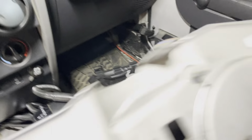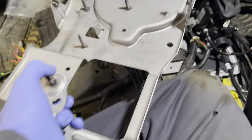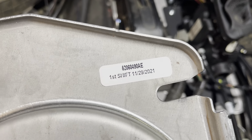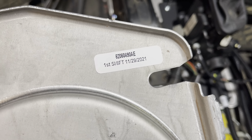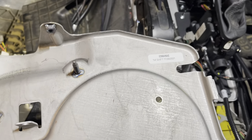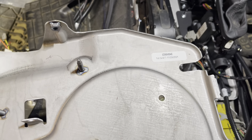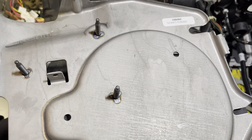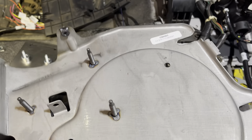To do this you need this thing — it's called the sled. There is the part number for the sled that you need to cover the hole in the floor on a stick shift. To convert it to automatic you need the sled because you need to cover that hole.